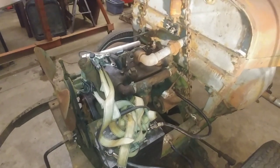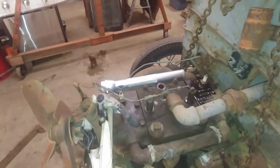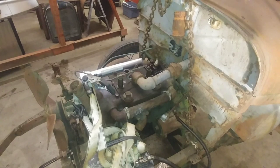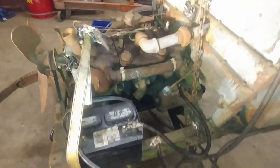I got the starter unfroze - it was froze up, and the Bendix spring was froze up too and wouldn't move. I pulled the starter off and got all that freed up so I could spin it over. We'll do a compression test on the old girl. I pulled this spark plug and looked at the front exhaust valve - it was stuck open. I knocked it around a little bit with a punch so I think we're ready to start making some progress.